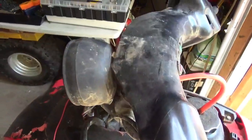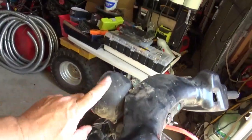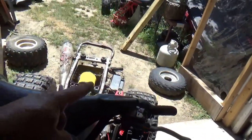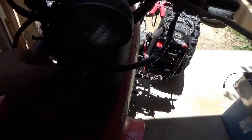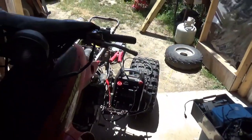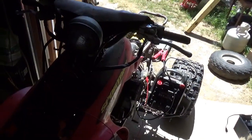We have no headlight, but given that these lights came on I'm feeling pretty good about everything. I'm going to check the headlight out separately. When you do check the headlight, do yourself a favor and unplug the wires first. There is still a battery there, and if the headlight is turned on and you don't know which wire is which, you can accidentally put your jump pack positive into negative and negative into positive - that will probably blow fuses and add another problem onto what you're troubleshooting.